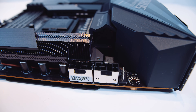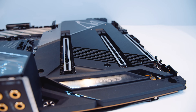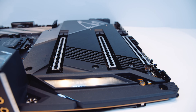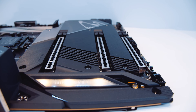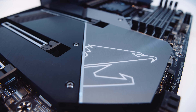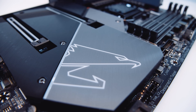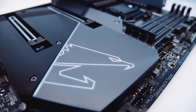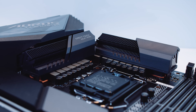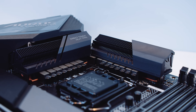There's also an additional PWM fan connector typically used for the fan on the backside of your case. Looking at the PCIe slots, there are three 16x-sized slots — although the top one runs at full 16x, then 8x, and then 4x towards the bottom. Because this is a Z490, it does not have an actively cooled chipset, but it does have a big eagle on there. Now let's take a look at the VRM — it's a 14-phase VRM, pretty standard for Aorus boards. The heatsinks are very, very chunky and will cool all of the VRM.